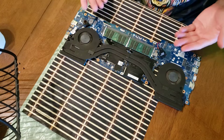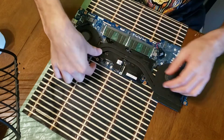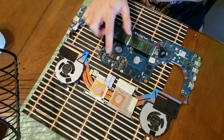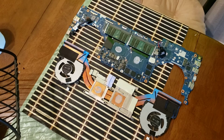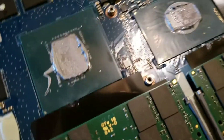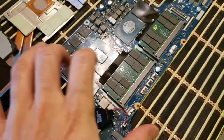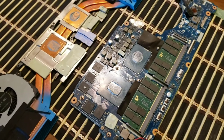I'm just going to pry it up a little bit here — there we go, and it just pops up. Now this is fairly new thermal paste. As I mentioned, the MX-4 from Arctic is on here already. Let me zoom in to show what it looks like and how well it had spread. I previously used just the pea-sized method on there. You can see it's spread out fairly well. I've watched a good video on comparisons between the way you apply thermal paste, and I'm going to do the credit card spread on this attempt with the Thermal Grizzly.